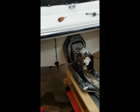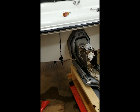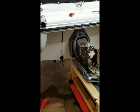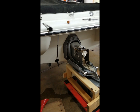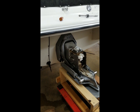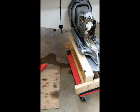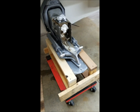I picked up a 2004 Stingray with a Volvo Penta SXM outdrive and had some issues with it shifting. In forward, RPMs would come up but it wouldn't engage the prop, and if you brought up the RPMs a little more you'd get a big clunk, then it'd be fine. I let the guy convince me it was a shift cable adjustment, took it out for a test drive, came back, he said everything was great — took it home, took it on the lake, everything was not great, doing the same thing.